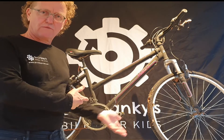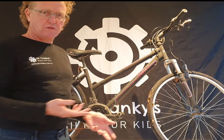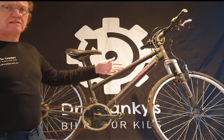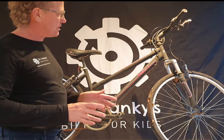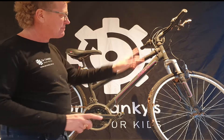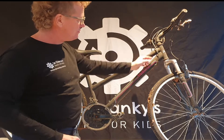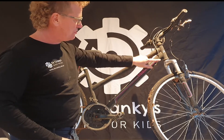Obviously you do this assessment on the side of the road before you load it in the car — whether it's worth keeping or worth donating. So the first thing to check on a bike is whether the frame itself is intact. The main thing to check for is any cracks in the frame at the major weld points, the most common place being up at the head tube and the junction into the tubes.